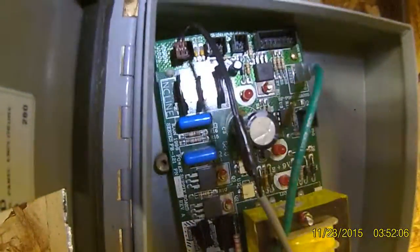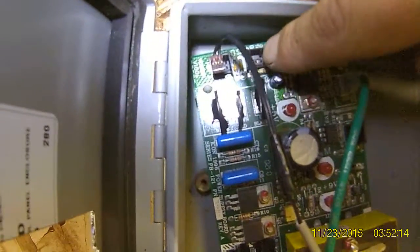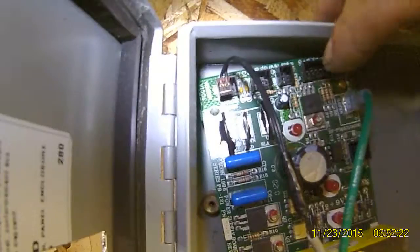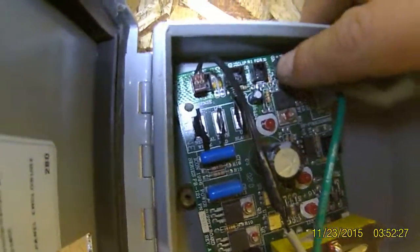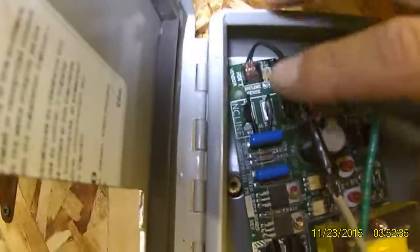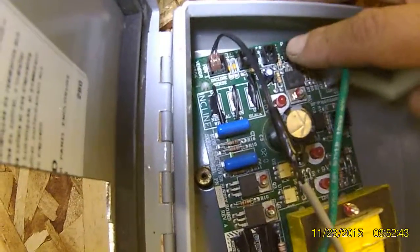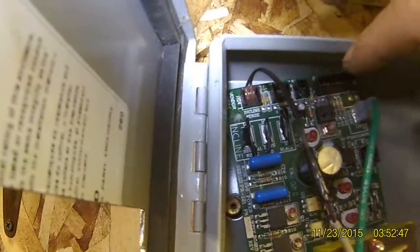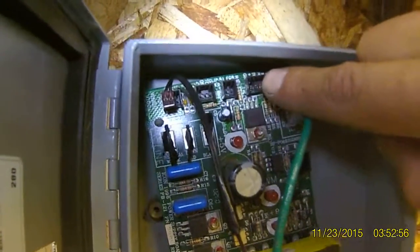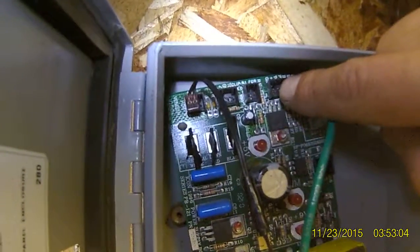The ground/five-volt/tach connector has both outside pins at five volts — they're actually reading 5.01 — and the inside is ground. The one labeled 'SNSR' is the hall sensor for the treadmill; it reads five volts. I originally hooked it up to that one but it wouldn't give me enough power. The amps just aren't there, though they are in the incline sense connector. On the main connector, the end pin labeled GND is ground and the other says plus nine volt, which was actually reading at almost 12 volts.